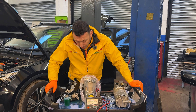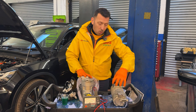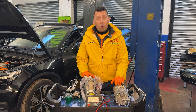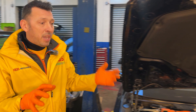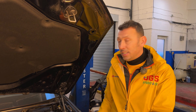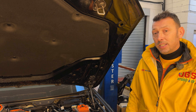So from a simple problem, a bigger one has developed — coolant into the high voltage system is critical and has ruined the whole system. From an operational perspective, some components have to be replaced, like the AC compressor. There's a chance the system can be flushed and might be okay, but it's a big task. All the pipes have to be flushed — a very tedious job. We need to make sure no moisture is left inside. We're going to use nitrogen — free of oxygen — to flush the system. It's going to be a very difficult job.